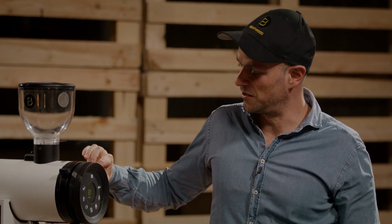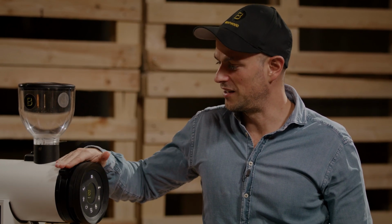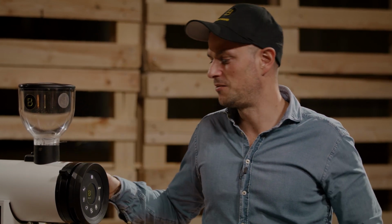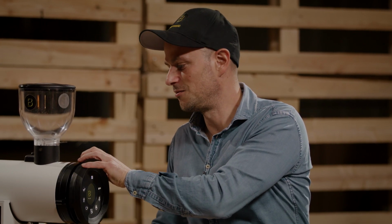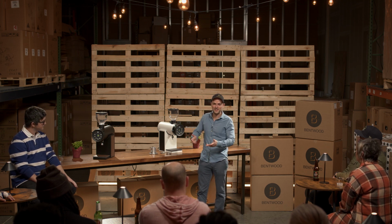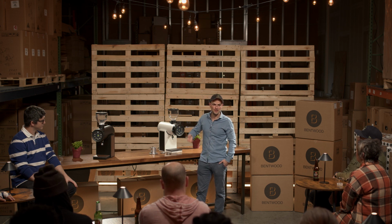And as well, people are worried, you know, is it going to move by itself? But it doesn't. It has exactly that feeling: it stays where it is, but if you want to move it, it moves. And to your point on the micron setting, you can always read from here if it's properly zero calibrated, so you don't need to open it up. You just keep turning when the grinding chamber is empty, and you can try afterwards yourself. Where you get that resistance is where we set it initially to zero. And if you open up the grinder because you still want to clean it, you always get back to that same point, so you don't need to recalibrate as you open and close again.